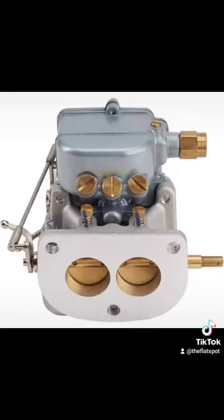One of the largest problems we had with this carburetor was this aluminum base. The base was very well known for creating a great deal of condensation that would pour onto the engine and look like an eyesore. It actually happened three different times that the base froze enough that it actually stuck the throttle open. And the fact that they generally only lasted a few months before needing a rebuild was pretty much the last nail in the coffin for me.